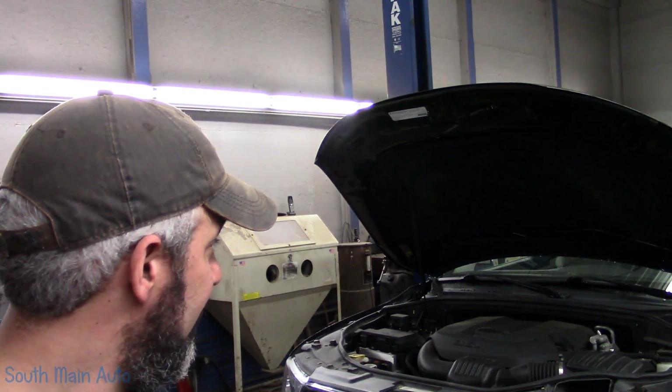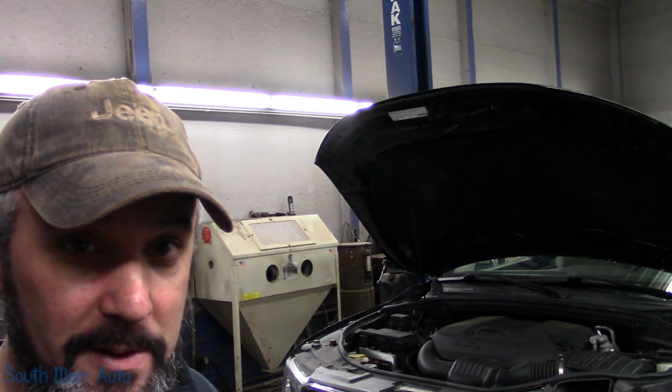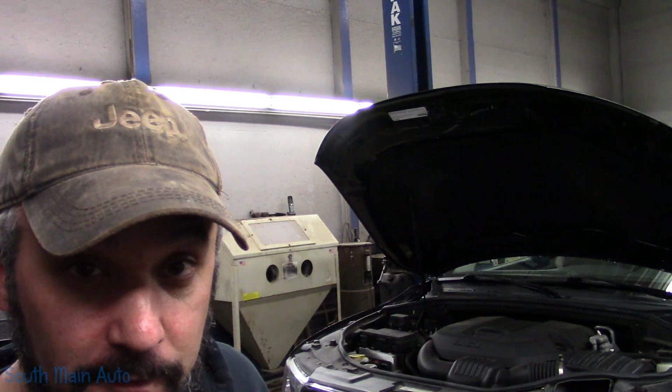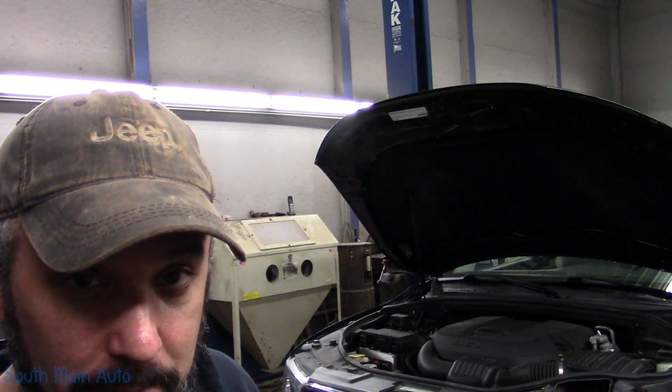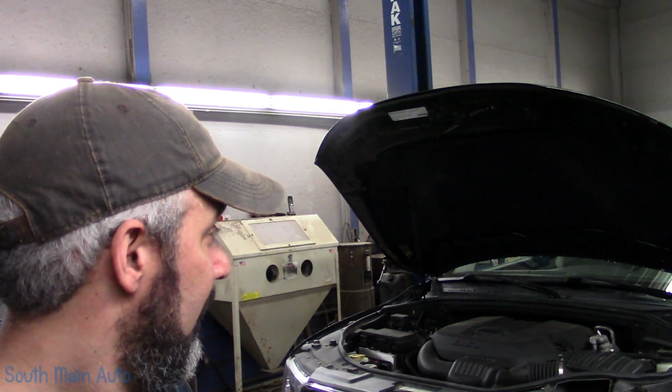I put a little sniff in it, wanted to make sure the compressor had the ability to work, and then I left my charge in there, and as you can see, went along with the old sniffer to look for a leak, and lo and behold, we found one. The plastic clips, aluminum hose, and salt strike again.